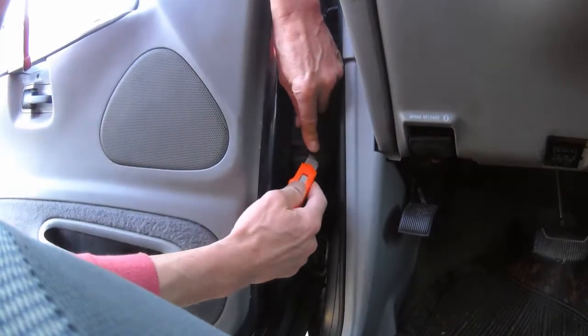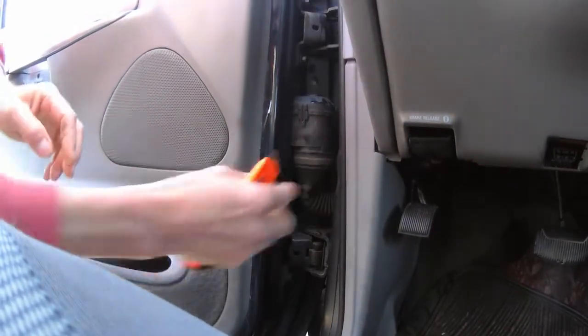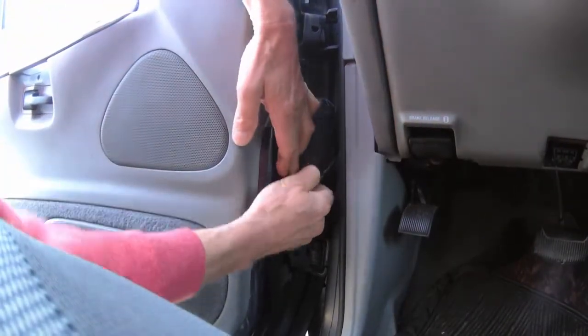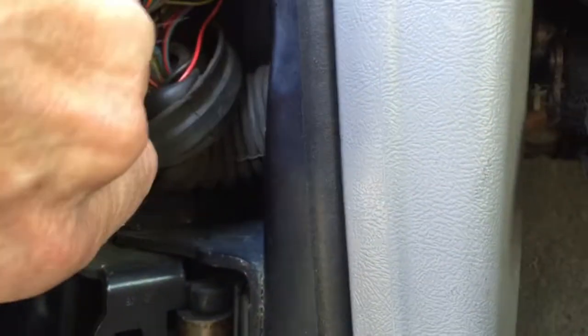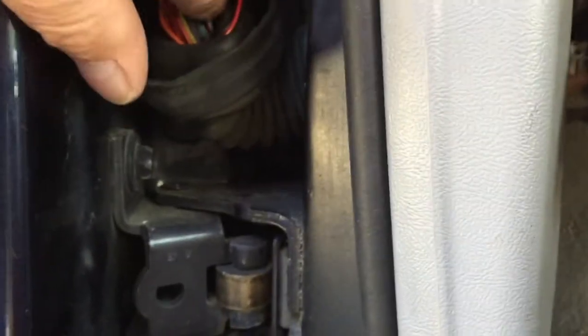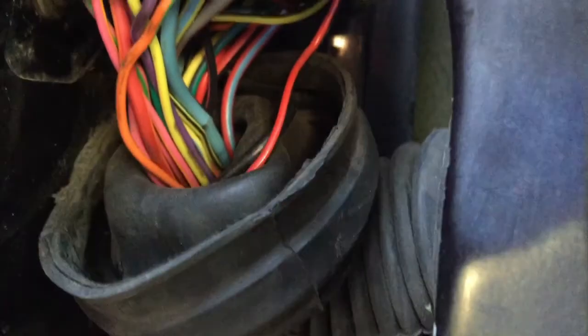Get this boot tight. Zip tie is loose. Drop this down, let's see if we can see a wire in there. It's broken. Now if you look inside here, the wire that supplies — and there you can see it, right there. See the cut, see the break. So we're going to remove that, get that repaired.